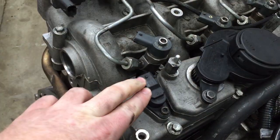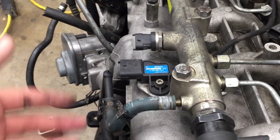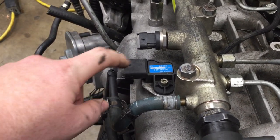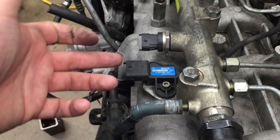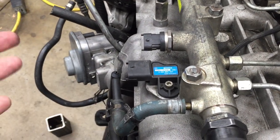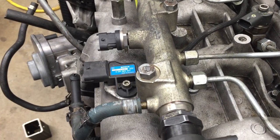There are a couple things we can check to get a brief indication of what's going on. This is the MAP sensor — the Manifold Absolute Pressure Sensor. This is what controls all the fueling on the engine. When this is dirty, it won't read correctly and will cause more black smoke, so definitely keep this clean. If it fails, you get a pretty good indication — the sensor ranges will be way out and it'll trigger a check engine light. If you're not reading something like 14.7 PSI at sea level or one bar — here at elevation I should be reading about 12.5 PSI — something's wrong with this sensor.